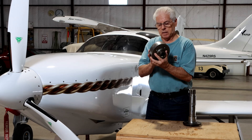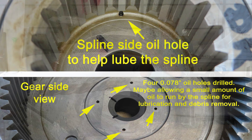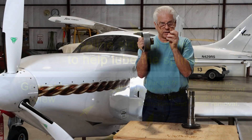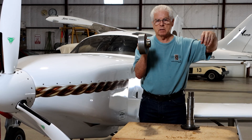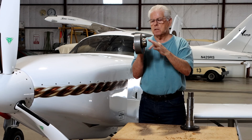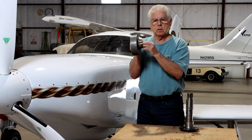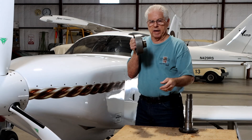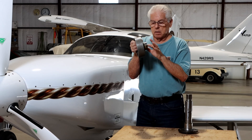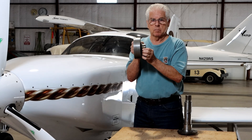What I've done is I've drilled four holes in the ring gear and they pass all the way through to the spline side. My thinking is that since the oil would normally come from the filter, go into the front of the gearbox, travel back, and lube the bearing — some of that oil will make its way into the splines, pass the splines, and go back in for recirculating. The hope is that it would also carry some of the metal particles that broke off.